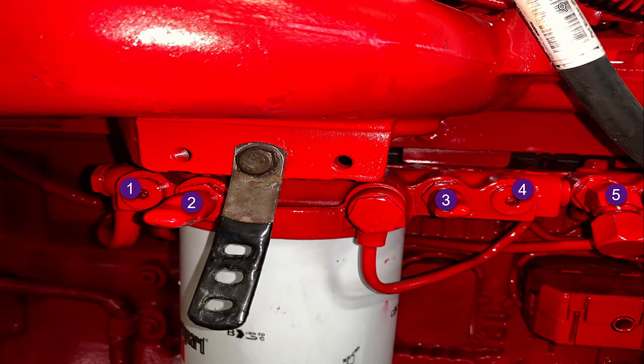Here we have the fuel filter assembly. Fitting number one is a test port — you would take that plug out and screw in a gauge that goes from zero to 30 PSI. You would then use the Insight software program to run the electric lift pump, and you should have a minimum of 10 PSI at that fitting. You never crank the engine while doing this test; you're just using Insight to run the electric lift pump. You can also key off, wait a couple of minutes, and do a key-on once your test gauge is in place — the ECM will run the lift pump for about two minutes. You need a minimum of 10 PSI at that fitting. If you don't, you need to check whether you have a problem sucking air or a problem with the electric lift pump.